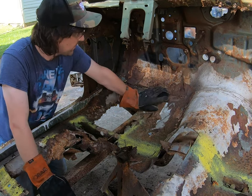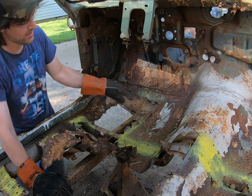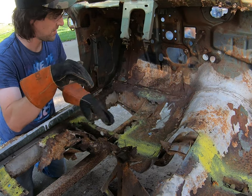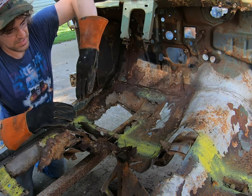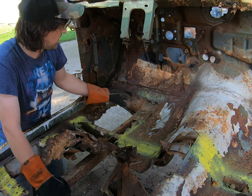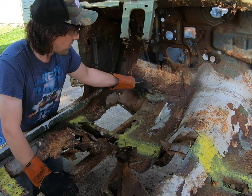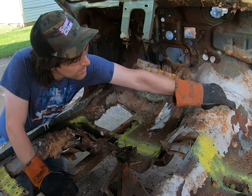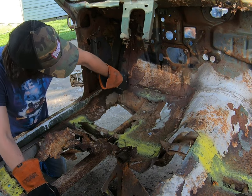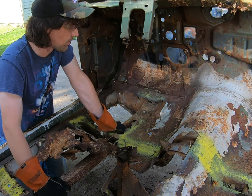Up here, what's different from back there where that laps — it just sits on top of the other piece. This one here, you have to imagine it comes up and goes down — this part here is like the back of my hand and wrist, and my fingers going down is the flange. The firewall does the same way — it comes down, and they both flange and are actually spot welded inside of here. So the best thing to do, in my opinion, is just cut right up next to it. Don't sink it all the way through in most spots. From about here to the middle and over, about the same place on that side, you can sink it through — there's nothing there. But here on this side you have this bracing that you want to contend with, and you want to be careful not to chop it up.